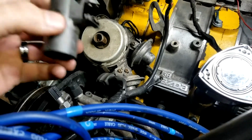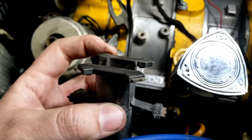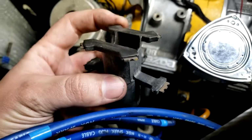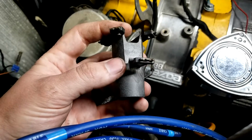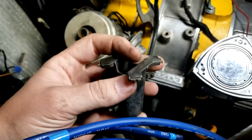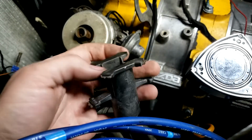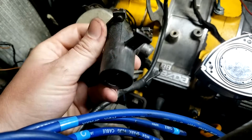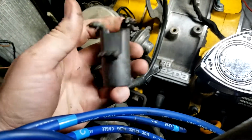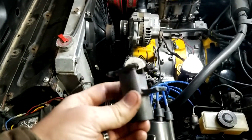just because of ignition stuff. So you can actually see that with the MSD boxes that it fires so much quicker that only the front portion of the rotors are burnt. It's actually burning only the front side because it fires so much quicker. But I'm gonna go and clean this off because, you know, it's a good thing to keep these clean.